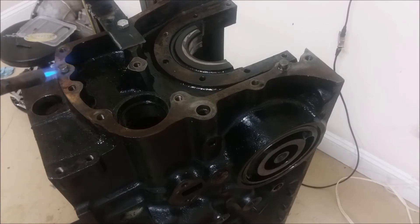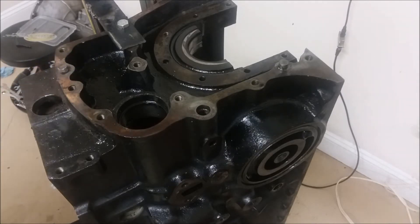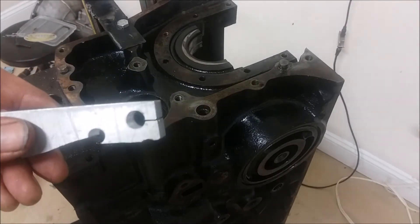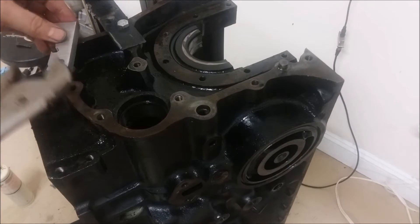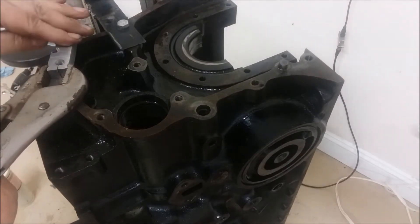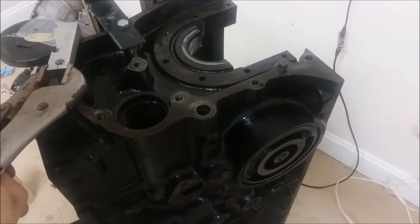Something important about these pins: you don't want to put steel to steel because it'll wreck it — it'll just mess everything up. As long as you're using a softer metal than the one you're working on, you'll be okay, and you'll only scratch the softer metal. So what I did was I took a piece of aluminum, drilled a hole in it, cut a slot in it, and built a piece from that.